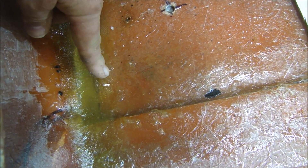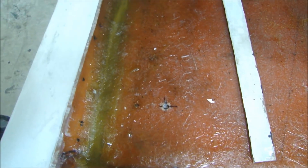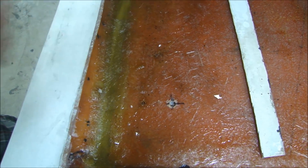On the other side, what I did was cut the lip off — this lip was here just like on the other side. I cut that off and continued the fiberglass onto the body so I have a nice smooth line all the way down and up into the corner, with the firewall all joined together. I'll show you how to create that seam so it's nice, smooth, and really strong.